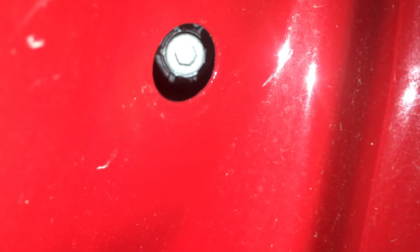The removal process is exactly the same for the front and rear door handle, except for a slight difference in angle for the retainer screw, which takes a four millimeter allen wrench. Most clips in this video are of the front door.